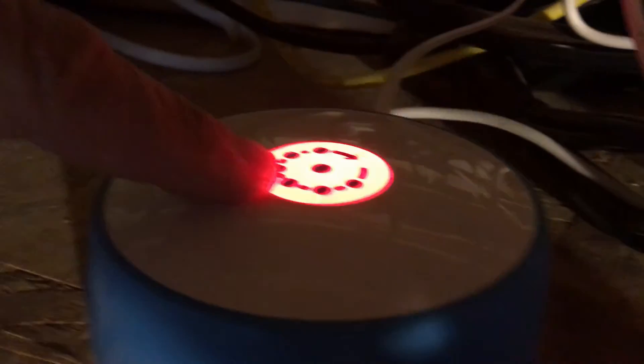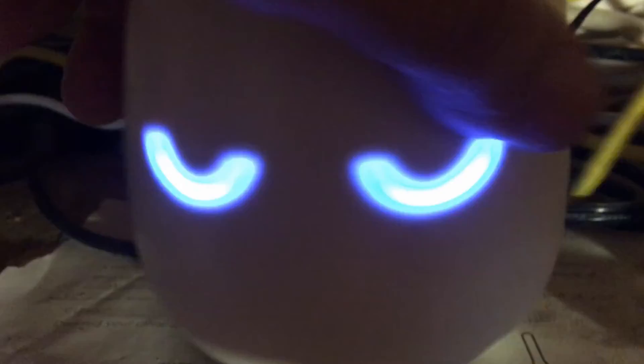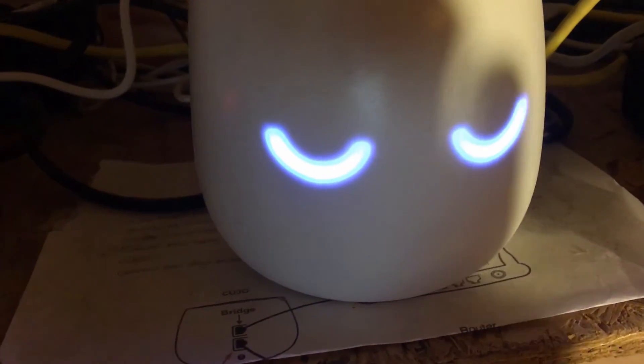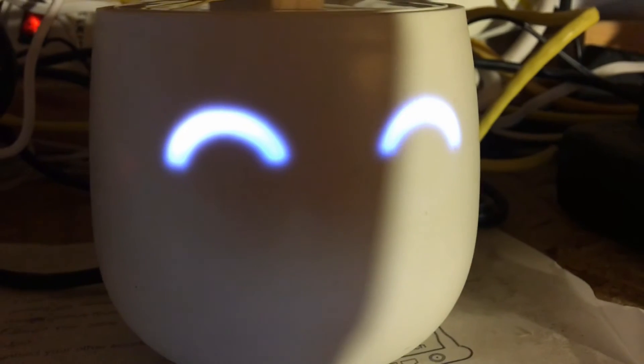I have the thing also connected to the main router, which is the Orbi. The modem goes through the Cujo — Cujo has two ports. You could put it by itself or set it to bypass so that it doesn't do the DHCP, because I don't like the device doing DHCP for me. I like to control that. So this comes back out to the Orbi, and then the thing is connected to the Orbi. This means it's unhappy — no connection yet. Got a smiley face on the Cujo, which means traffic is passing through.